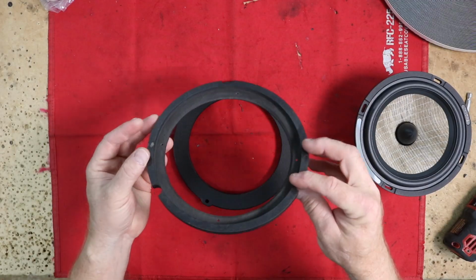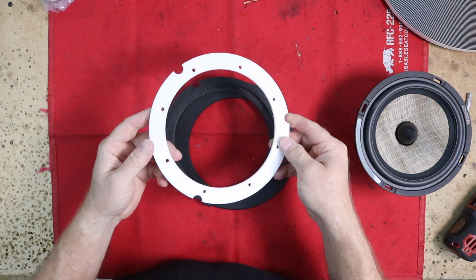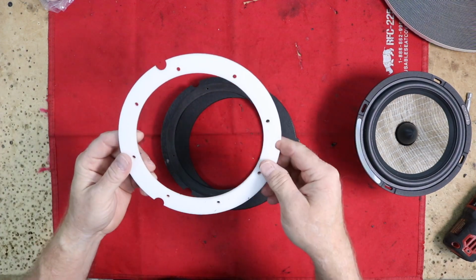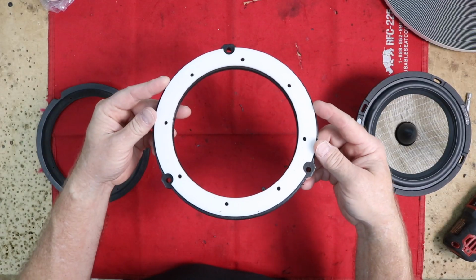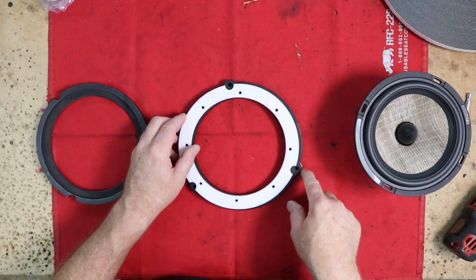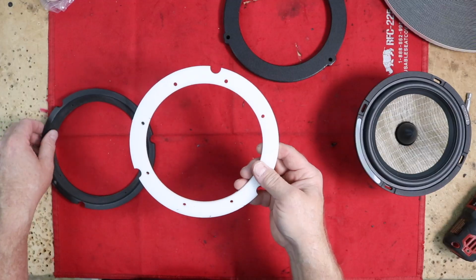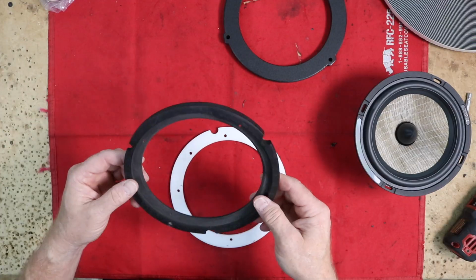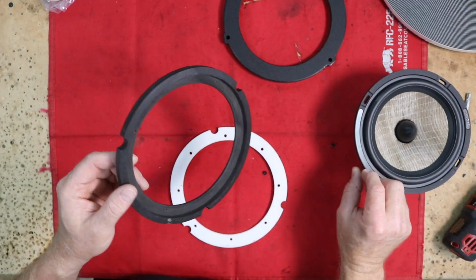There's a couple different things going on here. So the first step was to laser out this piece here, which allows us to mimic where these holes are located on this bracket. That way we can still put normal size screws in here instead of having to use some really long janky ones. Then we transferred that shape to a piece of 1/2". The next step was to countersink in for the thickness of the basket.